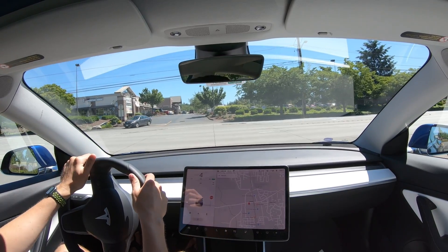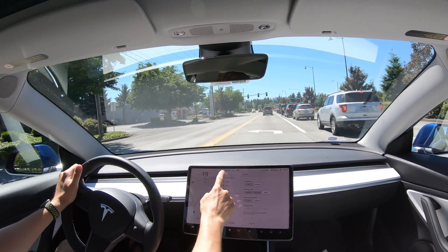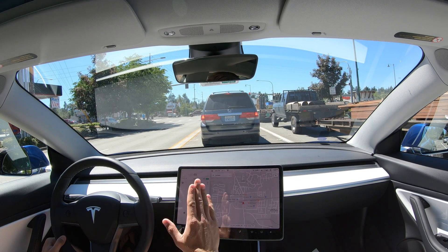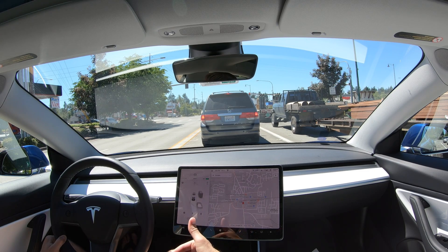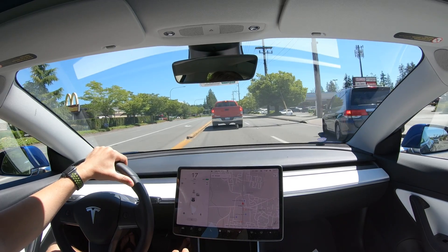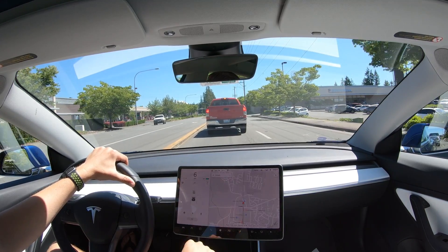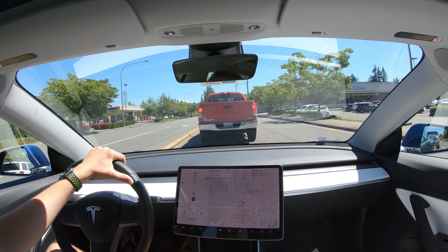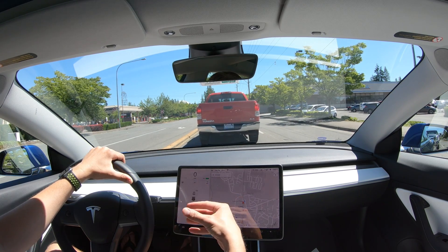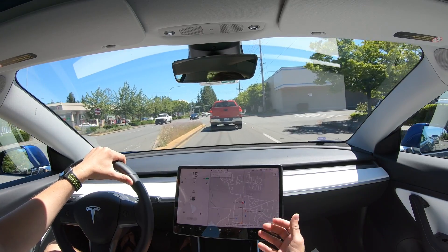So you've seen how low decelerates. Let's change it and put it into standard mode. You can do this while you're driving. Now watch the speed — when I let go, it's going to grip a lot faster. You can see I've come to a stop a lot quicker. Where you really feel it is at those slower speeds. Watch — I take my foot off the accelerator and look at how fast the car drops. Really quick. Whereas in low mode, I take my foot off and it's just very gradual, almost like a normal car. It's more something you feel than see, which is why I recommend you go out and put your car in both modes. They both stop your car — it's just how fast and how aggressively you want to be stopped.